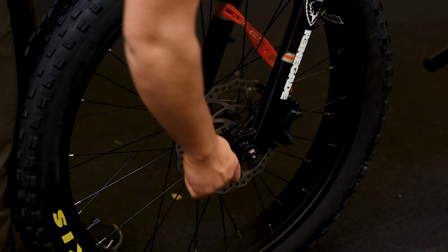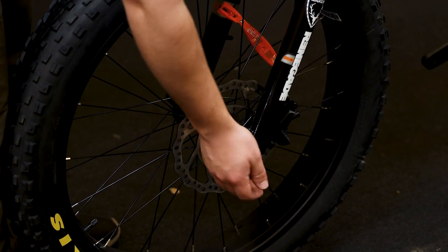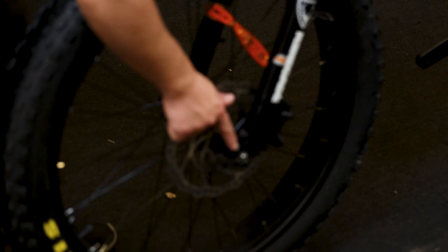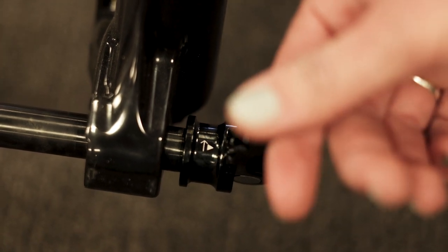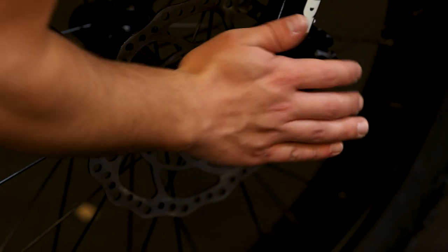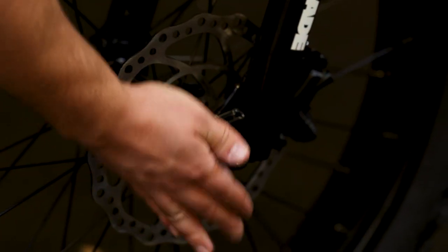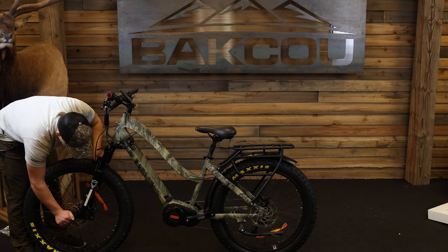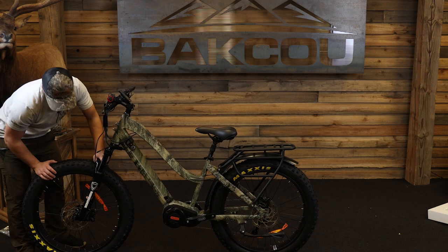Let's tighten this up. You just go to the arrow. Right here you're not going to be able to move it — you've got to put it in the slot that is etched into your quick release. Then you're able to rotate it so that it tightens on your forks. You do want this pretty tight because it is keeping your front wheel on, and you will just push it up like that.